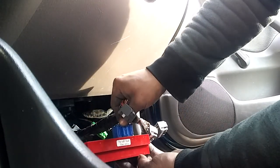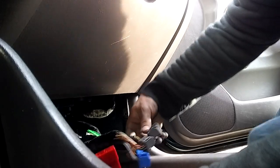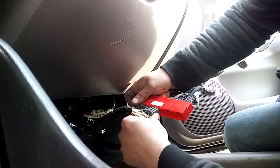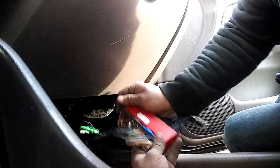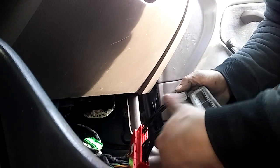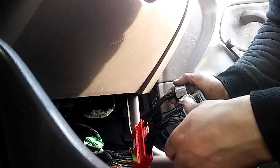You'll go ahead and plug them all in. Now all you have to do is plug in any OBD1 ECU that either has a tune or a chip so you can set it for this engine. A stock one will work fine, like this P05 — it just won't have a lot of power because the P05 sucks.